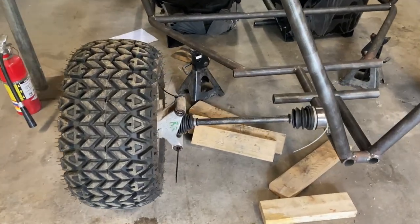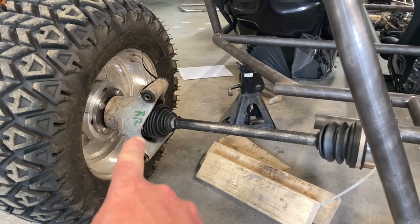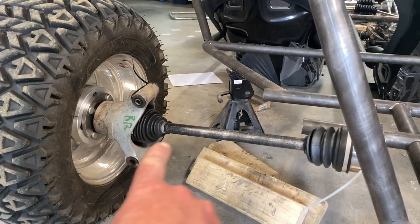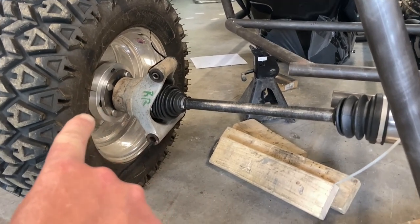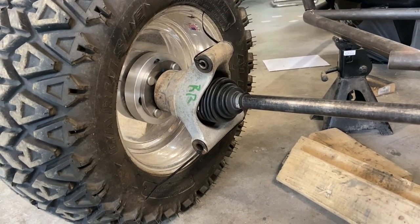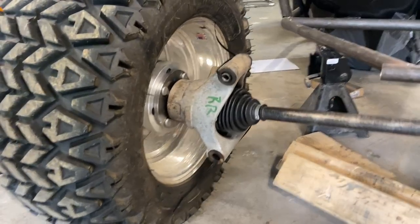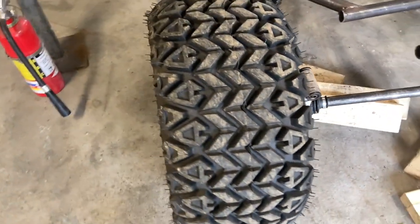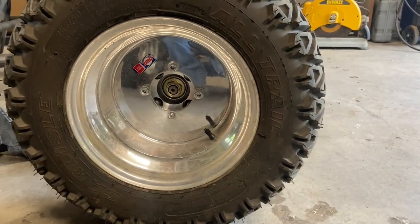This is what R&D looks like, folks. Big shout out to JD's Garage. They figured out this rear spindle setup to fit with the Miata axles. I've got an adapter on there. So the Miata axle puts out 4x100 bolt pattern. All of my wheels are set up for 4x110. I didn't have to buy all new rims for this because I want to test smaller diameters.